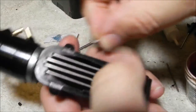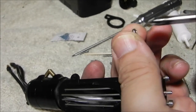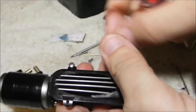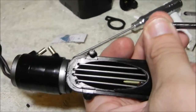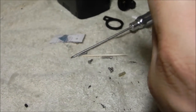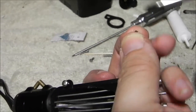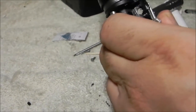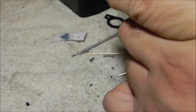Down here on the bottom we've got these stainless steel screws — they look nice, frankly. These holes have never had any threads in them, so you just want to start a screw in each one to kind of get them started. Because when you go to install this in the boat, you don't want to be struggling with it then. I should also add — the 8 or 9 holes you have in the boat can use these screws, and I'll give you some extra ones in the kit. You can use that drill bit to enlarge those holes to make it a little easier.